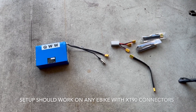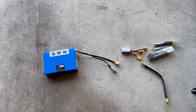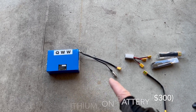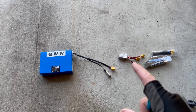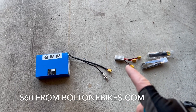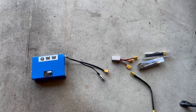To do this project you're going to need a bunch of parts. It's going to cost you about $460 to actually upgrade this e-bike. We'll start out with the battery — it's a QWW 20 amp hour battery with a 30 amp discharge. It comes with a charger and an XT90 connector. That is a dual battery parallel connector I bought off the Bolton e-bikes website, and that will let you connect a battery to an existing e-bike with an XT90 or XT60 connector and extend the range.